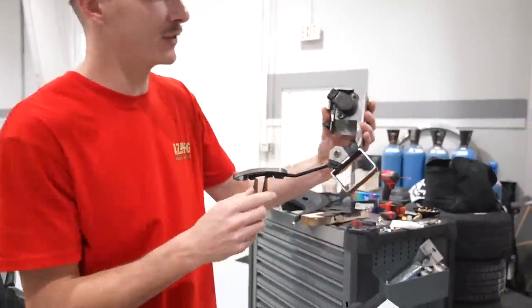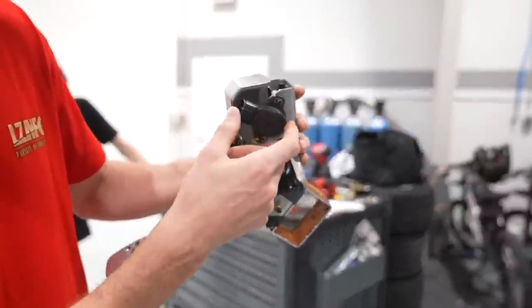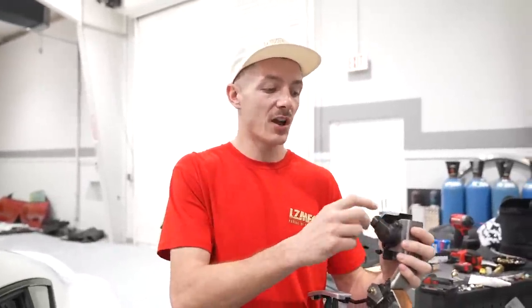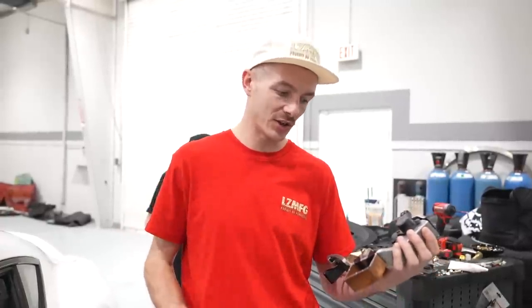So this is actually a 350Z gas pedal, and it has a TPS that'll be used as a potentiometer, because what I didn't understand, it's not just an on-off switch with the clutch pedal and the automatic transmission. The potentiometer actually lets you control the slip of the automatic transmission, which I'm pretty excited about, because that's gonna give you a little bit more feedback as a driver. And sometimes when we drift, you actually slip the clutch rather than fully disengaging and re-engaging it.